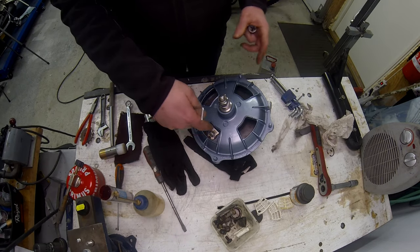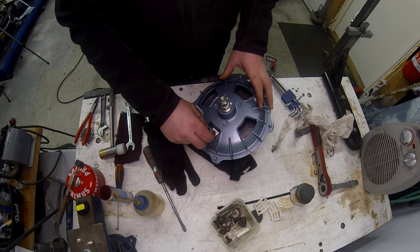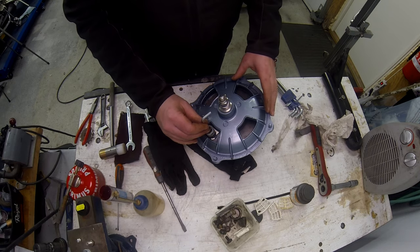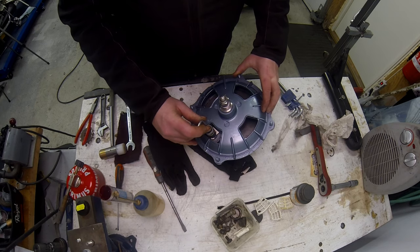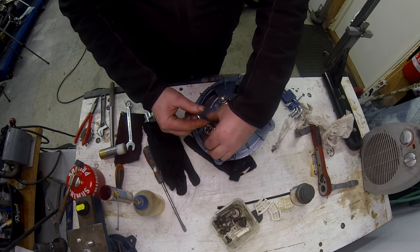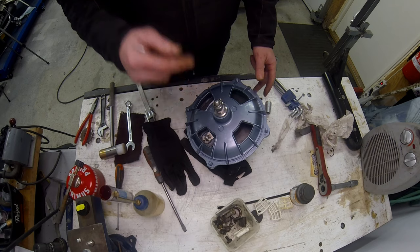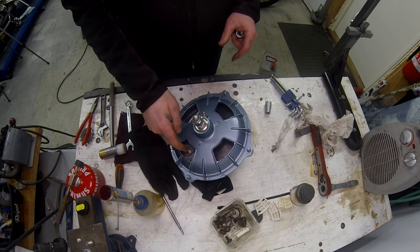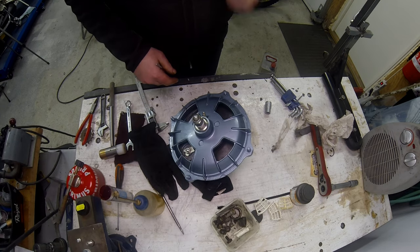The second to last thing is to lightly nip up the mechanism for adjusting the pad. To do this you fit a socket and wind in the grub screw until the disc locks up, then back it off half a turn and tighten down the outer screw. I'm going to leave it like that, because when I fit it on the bike I can do a minor adjustment then. I'm going to fit three of the windows and keep one window out so I can adjust and fit the tab washer when it's in the scooter.